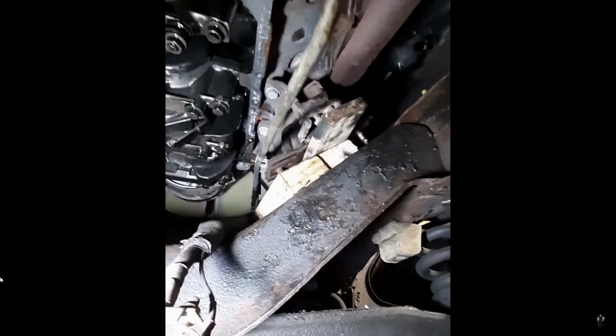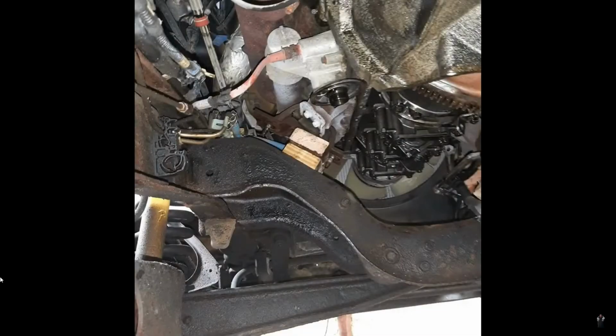All right, so you're gonna lift your engine. You're gonna have to put some blocks under it, set it up off the frame. After you lift the cab, you need to do these together, that way your radiator does not hit anything. We also took our fan shroud off, that way it wouldn't bind anything up, so it's just kind of floating there. There's just 2 bolts up top. We lift it with the dampener. That's how we get the engine up.